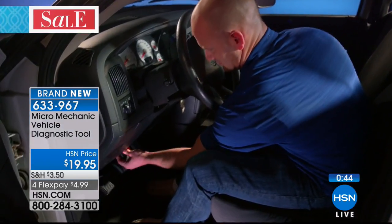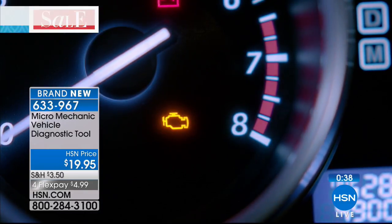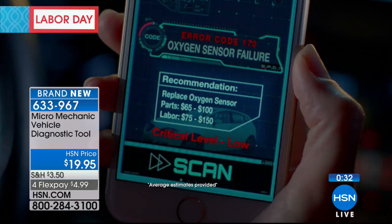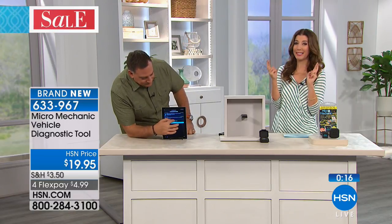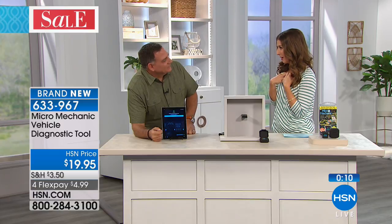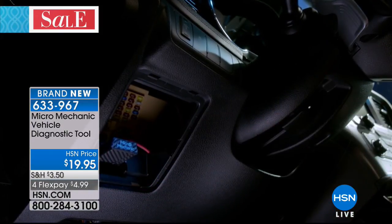Here's a true story — I had my check engine light on during a hot steamy summer in Minnesota. I spent money driving it to the garage and had them run their computer through it. They told me it was my gas cap — it wasn't on tight enough. Some sensor knows when there's low pressure in the gas tank. Here's the funny thing: if that ever happens with the Micro Mechanic, it will tell you to tighten your gas cap. On the other end of the spectrum, it could tell you that the engine's about to go — there's a crankshaft sensor, and if that's out of alignment, it tells you absolutely do not drive the car because that could cause even more damage.